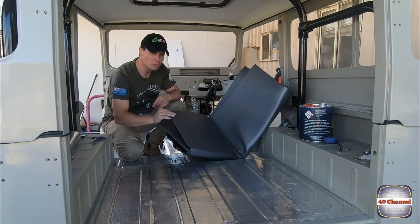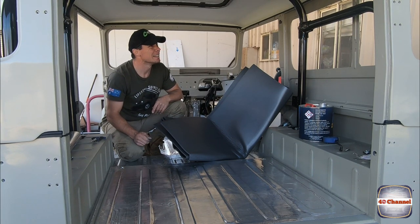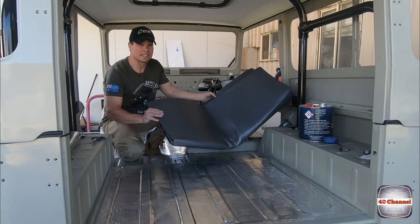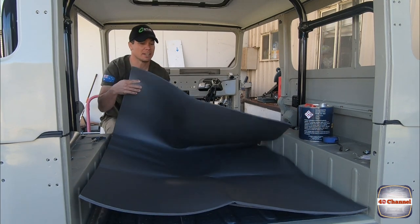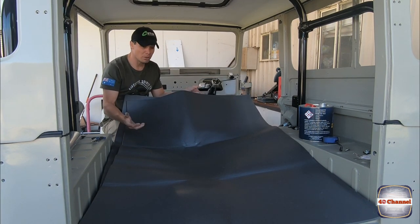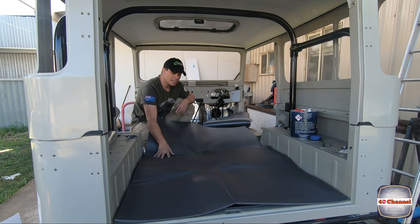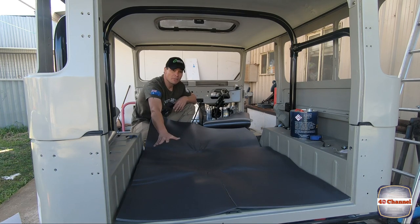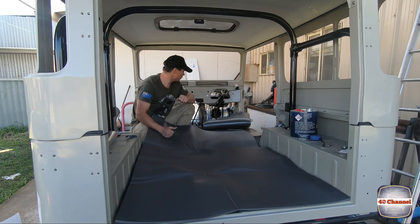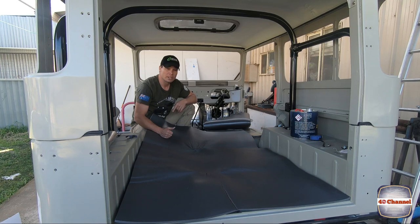Right, now we've got the reso mat down, what we've got now is our underlay. I've chosen a waterproof underlay because we all know that even with my absolute best effort to make this waterproof, everything I've read says there are still little bits of leaks. And obviously if I'm out in the bush or want to do a little bit of water crossing, this stuff's going to be important. I'm just test fitting everything - they make this perfect size, there's two sheets and it's not very expensive, more than enough to do the FJ40. On top of this goes our vinyl floor.